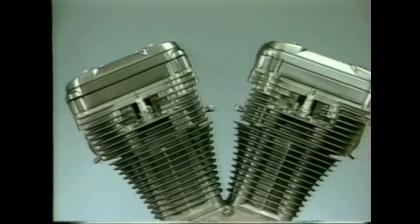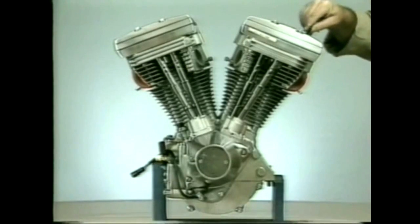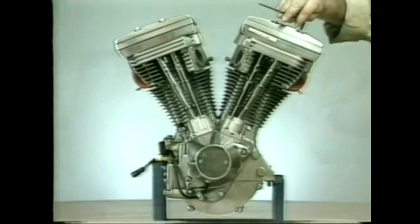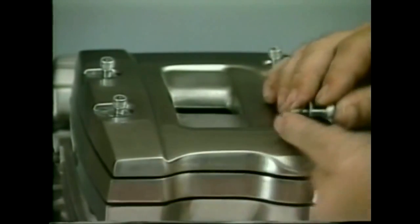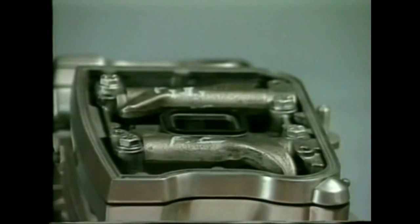By the way, this is a relatively new type of carburetor for Harleys — it's called a constant velocity or CV carby for short. Our next step is to undo and remove the four Allen bolts from the top cover of each rocker box using a 3/16th Allen key wrench. Each bolt has a metal washer and fiber washer. We can then lift the cover off complete with bolts in place. Beneath this cover we find a second cover. These covers will sometimes come off as a single unit if the seals have been baked from the heat of the motor. We now have exposed the lower cover's rocker assembly.